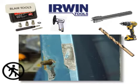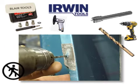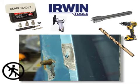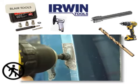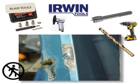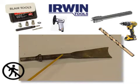Grind it flat so your cutter bit does not hit any snags or imperfections. That's no fun, right? Because then it jumps off its target and sometimes you break a tooth. Make your pilot hole once again, then follow up with the cutting tool and you are done. Alright, next is your last step. Take an air hammer cutting bit. Here's an example of a cutter bit from Snap-on.